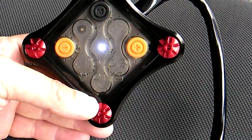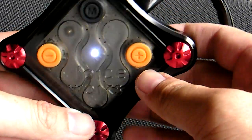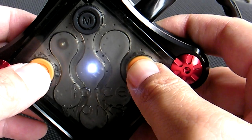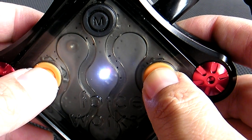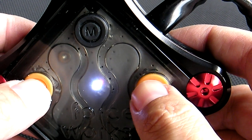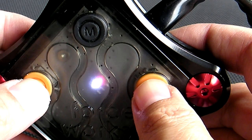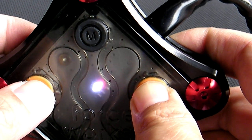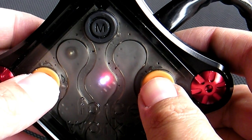Let's go ahead and start the scooter. We're in mode one — idle to 7,000 RPM. I'll increase fuel since it's easy to see the red LED. I just increased fuel; it flashed red, meaning it went into memory and added fuel into the programming. I'll keep adding fuel — one, two, three, four, five — wait three seconds, one, two, three — went into memory. You can hear the sudden drop in RPM. I'm just going to keep adding fuel until it's bright red. It went to memory and the bike died — too much fuel.